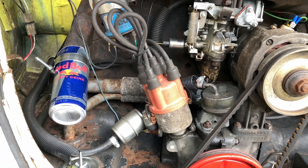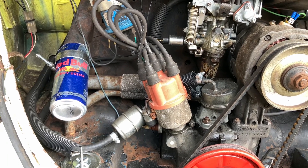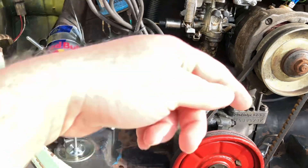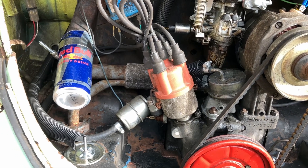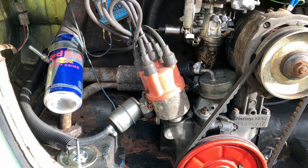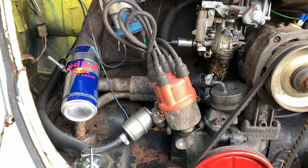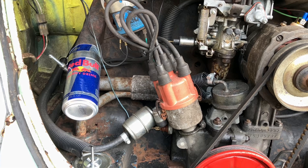When I did an oil change Saturday, I smelled fuel in the oil. One of the things that can happen with these fuel pumps is the diaphragm — if that gets any kind of leakage, it just starts dumping fuel down into the motor and it mixes in with your oil. The smell of fuel when I dumped the oil is indicative that that's probably what's happening, and that's also going to cause issues with your motor not being able to start properly. After I changed the oil out, the car started right up with no problem, ran for a couple minutes, and then died — so the vapor lock issue is still occurring.